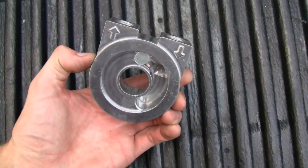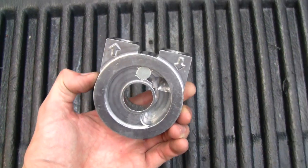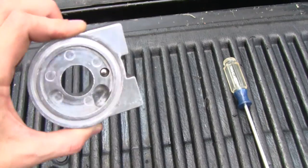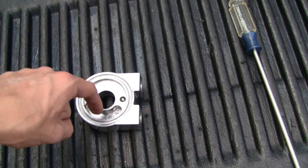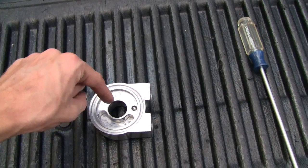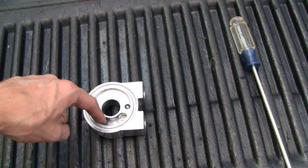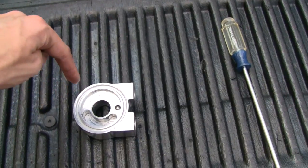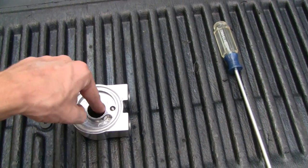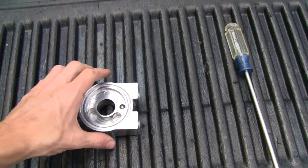What I need is for this thing to just flow straight through. When I'm not using the pre-oiler — which is all the time the engine is running, since I'm only going to use it at startup — I want it to function as it normally would, as if the sandwich adapter isn't even here. So the outside passage needs to be totally clear so oil can just run right through. It comes from the oil pump, goes through this thing, through the filter, and then back into the engine.